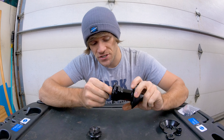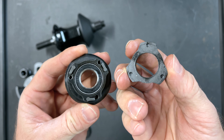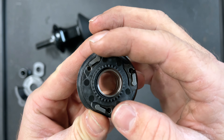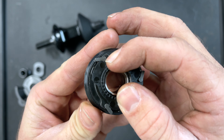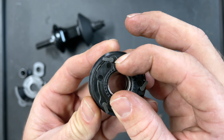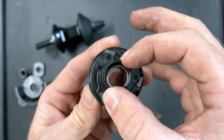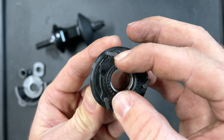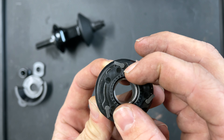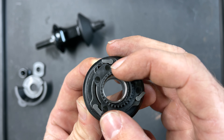What we're looking at right now is the wedge piece with the three wedges and ramps on it. You can get a much closer look at how this works — when the hub is rotating you can see that when it rotates into the pawls it lifts them up. We've already demonstrated how this thing stays in place as a cassette while moving forward. Moving forward, the wedge is pushed into the pawls lifting them; as soon as it moves backwards, they drop, and this thing is allowed to be a free coaster.